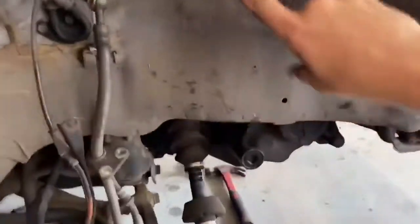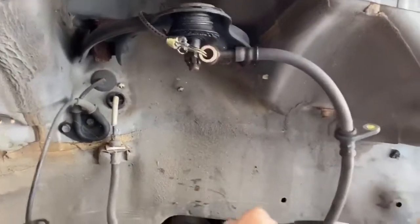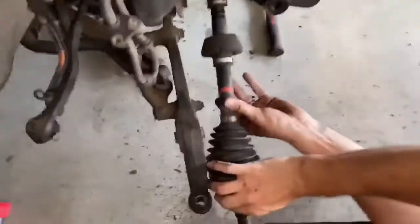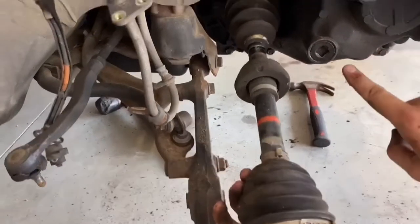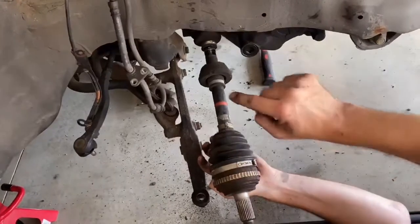Corey and I are over here working on the Integra. We got the strut tower out, bolts loose, bracket speed sensors out — these two 12 millimeter brackets are both out. The strut tower, spindle, wheel hub — everything is over there. We're going to get this passenger side CV axle out, then work on the driver's side. We got the half shaft, another one going to the transmission, and we need to get the clutch slave cylinder out and disconnect some sensors before we drop it.